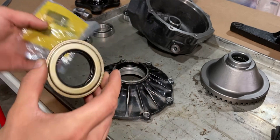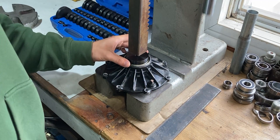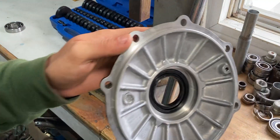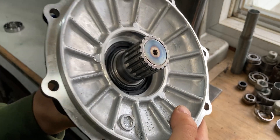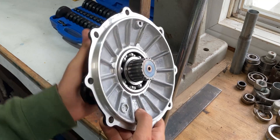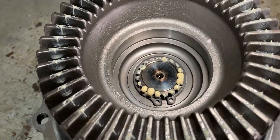Watch closely as I gently tap this sleeve flush against the control arm using an old bearing race. Now on to the next step — the rear axle spindle case. We're going to introduce a brand new seal, but we're using an arbor press to ensure that the seal goes on straight and snug, especially since the spindle case is made of lightweight aluminum. With the seal in place, it's time to reunite the spindle and the spindle case using the arbor press once again. Now it's time to install a deep groove ball bearing — the part that supports the spindle within the spindle case.